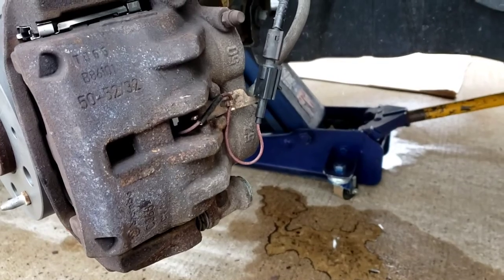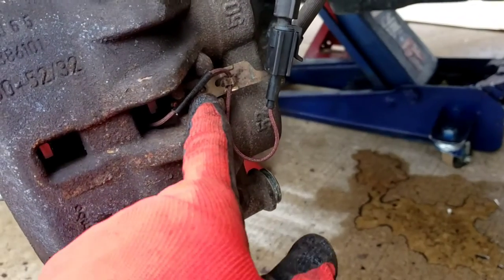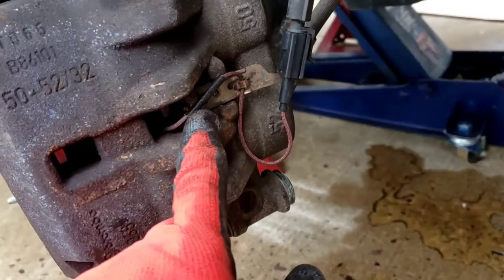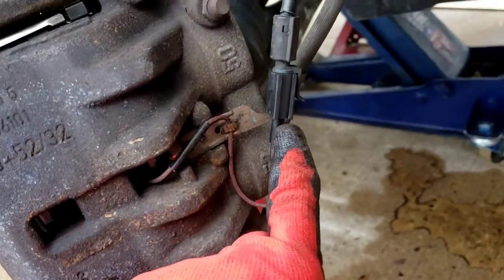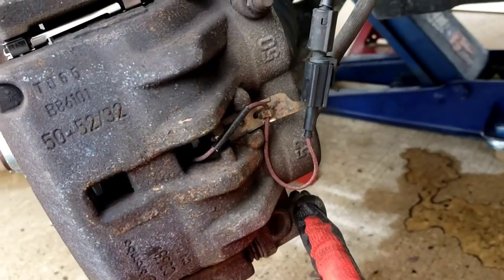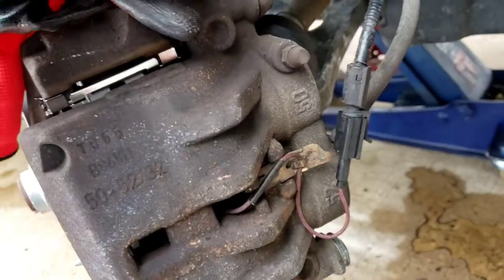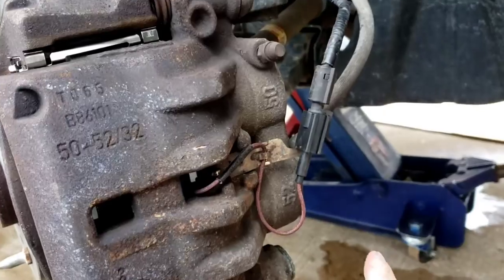That's what it's going to look like when you're all done. It's got a little nice protective boot there, which is cool. That's going to be pitched over here, secured there, clipped there, up out of the way. Tighten up your 6mm bolts and put the boots on. I like the original boots and the original bolts.